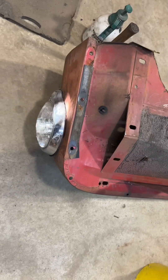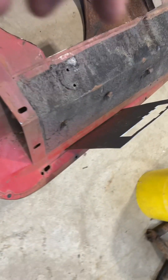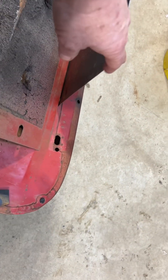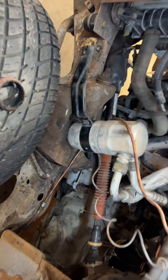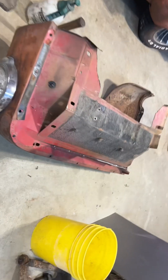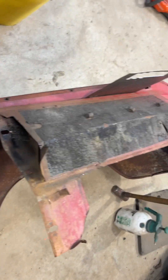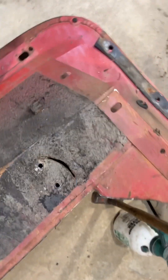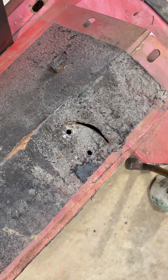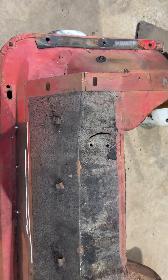I'm back — cut this off. I'm gonna make a panel, it'll probably go in here. I've gotta figure out from this height to the bottom so I still have room for the AC receiver dryer. This back end where I cut it up for the brake booster — I'm just gonna block it and put a hole in here just to let the breeze out. Looks like it might have lost a fan at one point in its life and that's where it went through — I didn't notice that before, or just forgot.